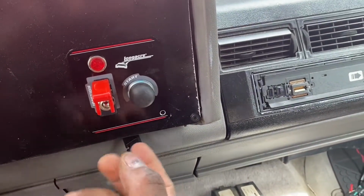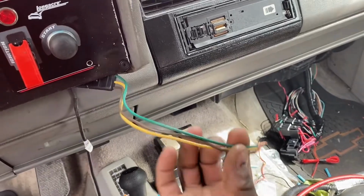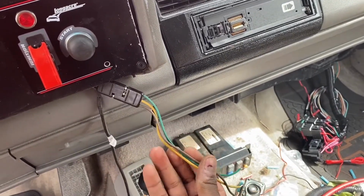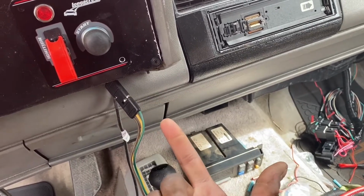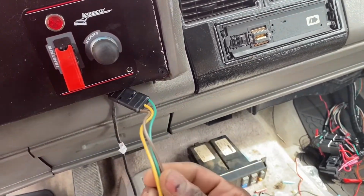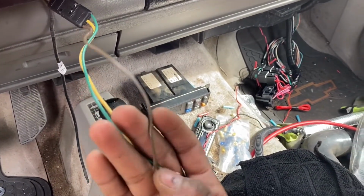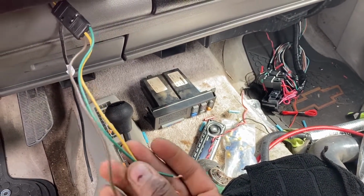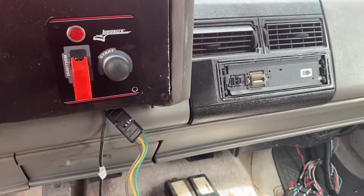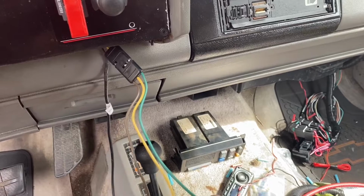Yeah, so ignition switch, boom, we're gonna fire that back up. And this one is kind of weird because it has like a 3-wire. We never count the ground wire, we just don't. Okay, get over it. We got a 3-wire. I'm thinking, do I want to hook this up to a relay, or should I just run this straight down to the starter? Because most of the time when you hook up a race ignition, and I did a comparison, like a little poll online.